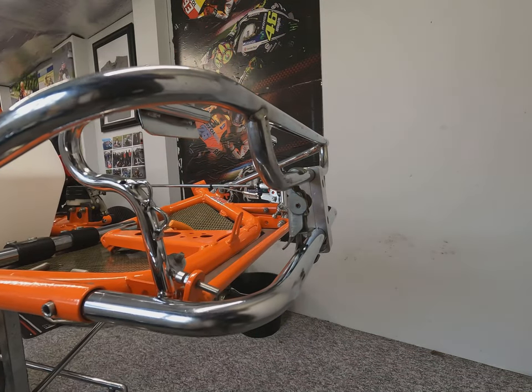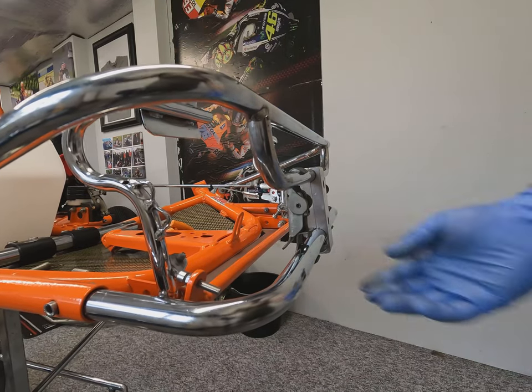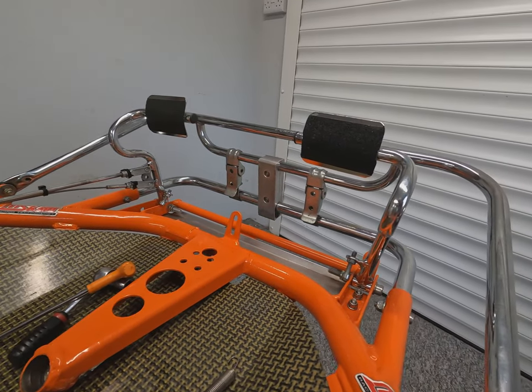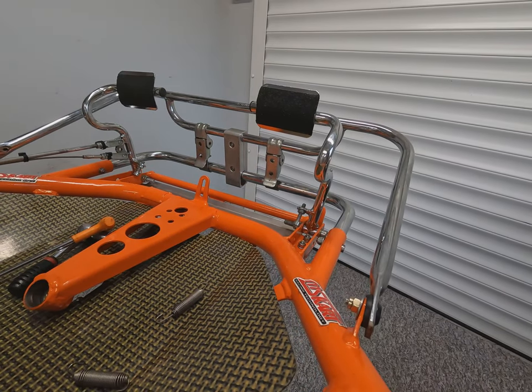These are the bumper clips, which hold the bumpers down to each other, sandwiching the nose cone brackets and holding the nose cone on. And that's the front end pretty much complete. All that's left to do is install the return springs to the throttle and brake pedals onto the top bumper bar, and the front end is done.